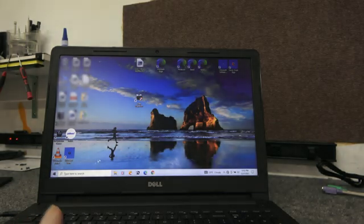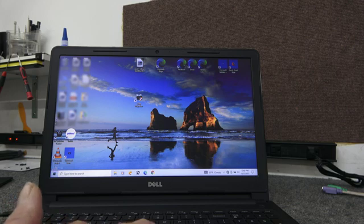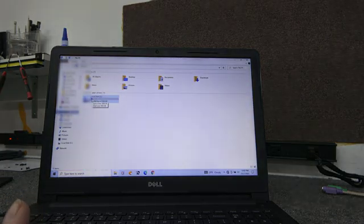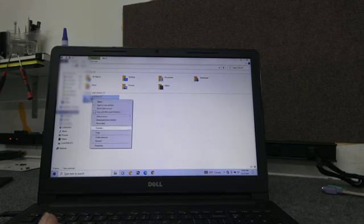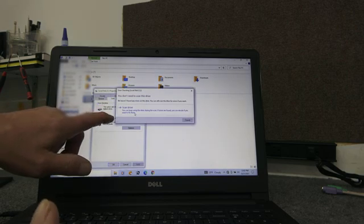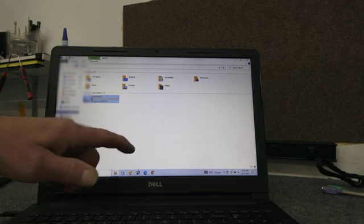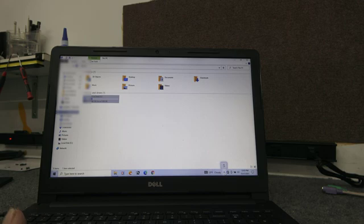If you're having issues or errors of any kind, you might want to take care of those first. You can go to your command prompt and run a check disk with slash R or even slash F — the R is the more thorough disk checking process. You can also just go right to your C drive, go to the properties of your existing hard drive, go over to Tools, and you can run the disk checking process there. It's kind of a basic scan, more like the slash F.